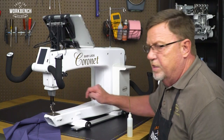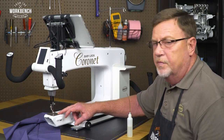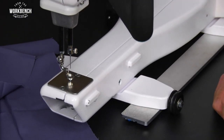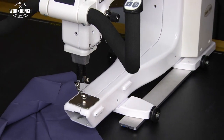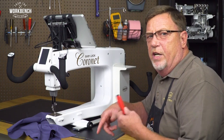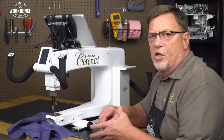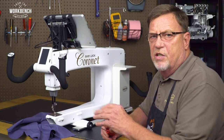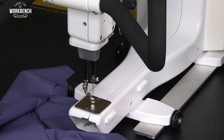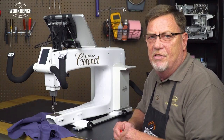Your wheels, your rotary hook, and your tension mechanism are your big concerns. Once you've completed the steps, it's a good idea to go ahead and thread up your machine, install your bobbin case, and do a little sewing on some scrap fabric just in case there might be a little additional oil there. So now that you know, get out and sew.